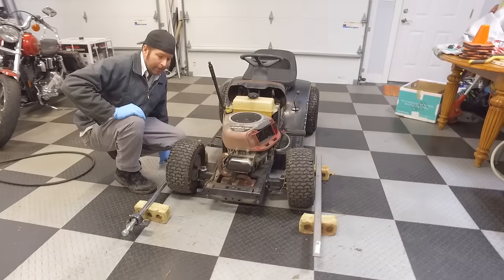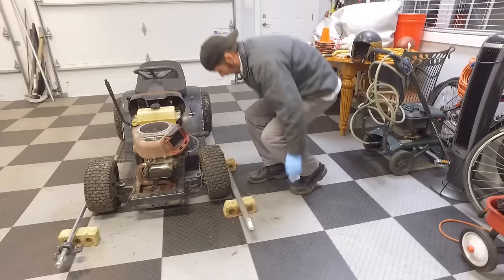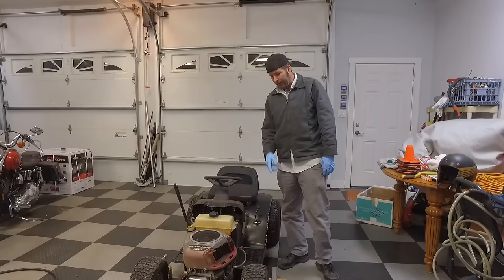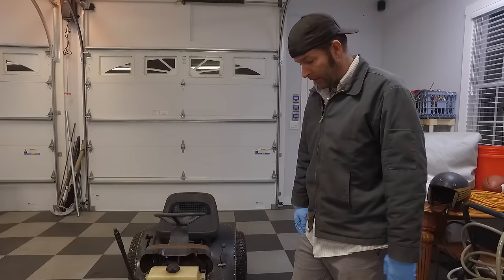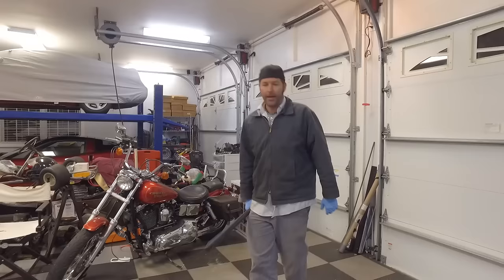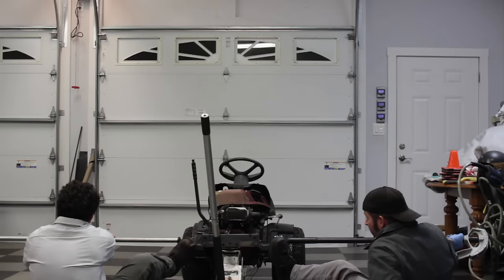I'm not worried about caster or camber, although the camber is pretty ridiculous. Are you going for zero toe? Yes. Look how far off this is — that's bad, that's why she's so sketchy going down the road. This is probably off because of the tree incident. So I'm gonna want you to hold that tire and I'm gonna twist on this one to try to get the alignment. I'm not sure that bar's gonna be strong enough. This one has never let me down. Well, prepare to be let down.